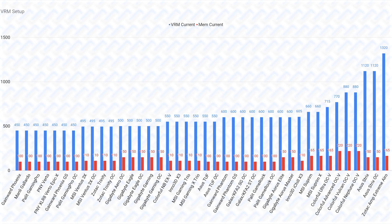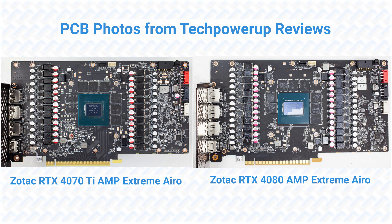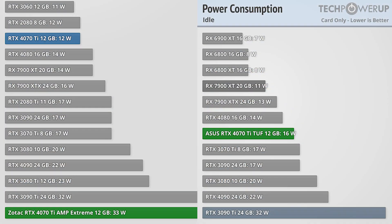VRMs should only be a concern when comparing two cards with similar cooling and power limits — then there's no reason not to buy the card with the better VRMs. A card with a 600A or higher VRM is nice for peace of mind when overclocking and shunt modding. However, Zotac has seemingly used the same PCB and VRM as their RTX 4080 and 4090 cards on their 4070 Ti Amp Extreme. While this looks amazing on the surface, it causes a very high idle power draw — higher than the 4080s and even some 4090s. The sheer number of VRM phases likely makes it inefficient at low loads, so an overly overkill VRM is not necessarily the way to go.